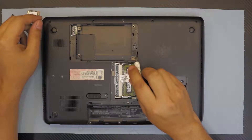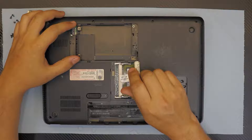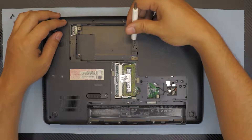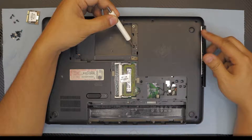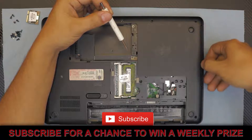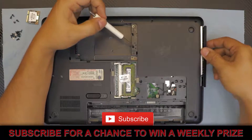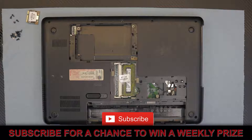Once you remove the screw right under the cover where the hard drive was, pull your flat screwdriver inside there and pull it toward this side so the CD-ROM will just pop out. Remember, you don't want to yank the DVD-ROM from the front or you can break the cover. Just do this and it will come out — that's the proper way of doing it.